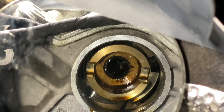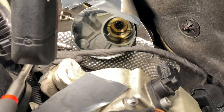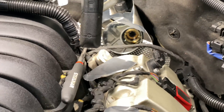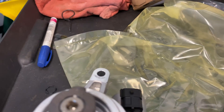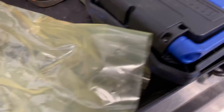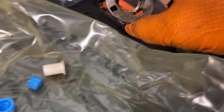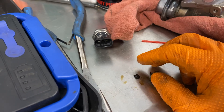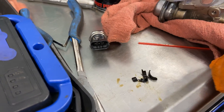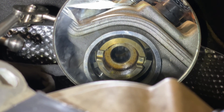I've been scraping at it with a pick. Usually they just break apart, so you've got to be careful and try to pull it all out. I have a mirror rigged up and taped to the firewall. The flared end goes in like that — and as you can see, there's a bunch of broken plastic debris that came from this piece. You're going to have to clean the rest of this stuff out of the inside of the cylinder head, because the rest of that piece is in there — so you'll need a pick to dig it out.